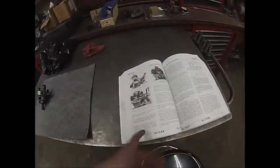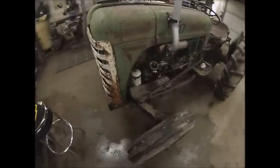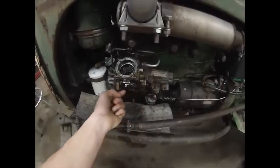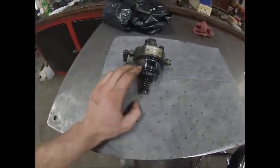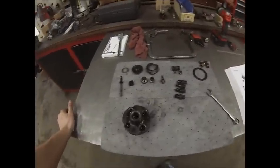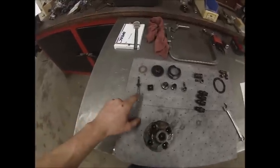There's a parts breakdown in the book and there's really nothing in there. The governor housing is in here, and this is for all intents and purposes a crankcase where your cam and everything is that runs the plunger — there's nothing in there. But there's an O-ring here and an O-ring here and some other stuff in there that we've got to work on. Here's all the parts — like I say, there ain't much in this pump.